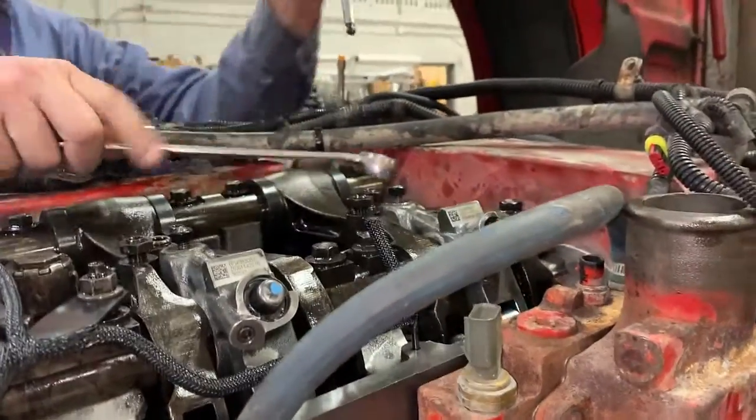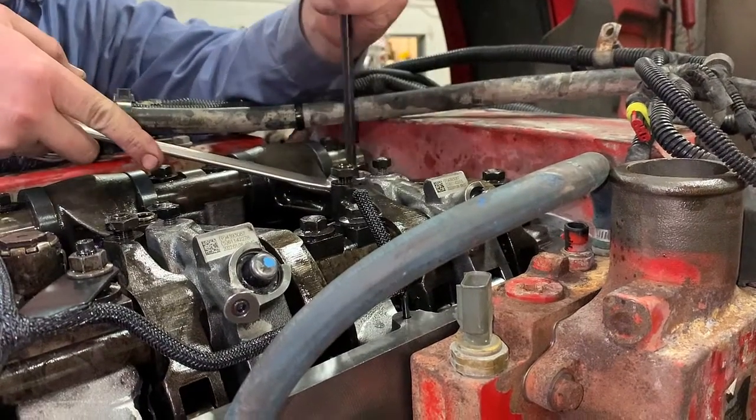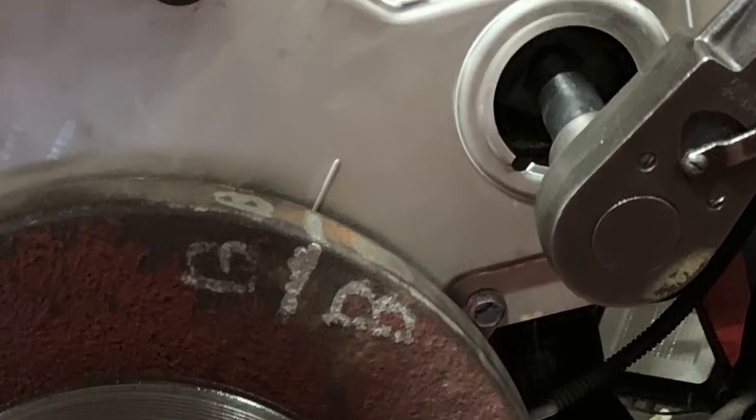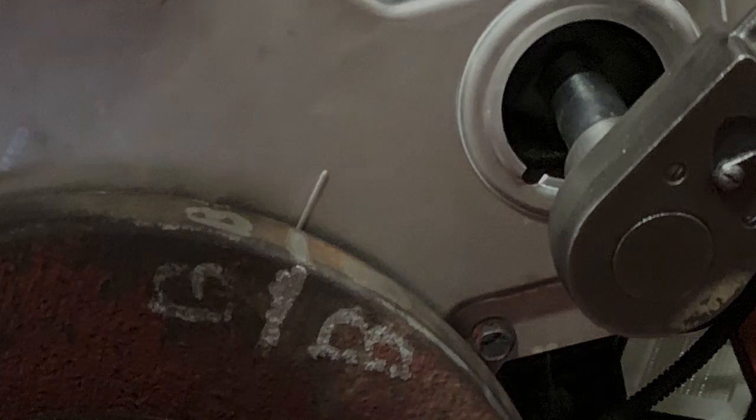I believe the injector hole is an eight-millimeter allen for the screw, the valves I think are six, and the jake hole is three. And here's our damper lined up with the mark on the cover. If you're off a quarter inch or three-eighths of an inch either way, I don't think it's any big deal — just make sure that you've got the right marks. If your damper is pretty rusted like ours, you can go back and look at my damper video to figure out where your marks are. Good luck. See you next time on Neural Splendor.